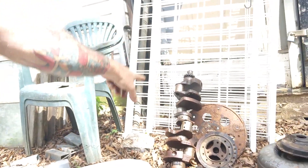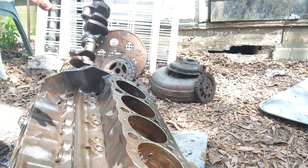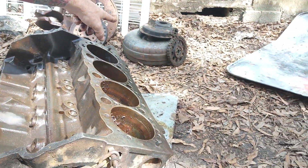Because the end of that crank right there is what is attached to the torque converter — that big round thing. That's a torque converter, that's on the inside of your transmission. This crank takes the explosion, sends it through the torque converter into your transmission. Your transmission takes one bit of power and converts it into higher and lower powers with gears and pumps. So it can take one RPM and make it more — then it converts it to your rear end, which also transfers the power.